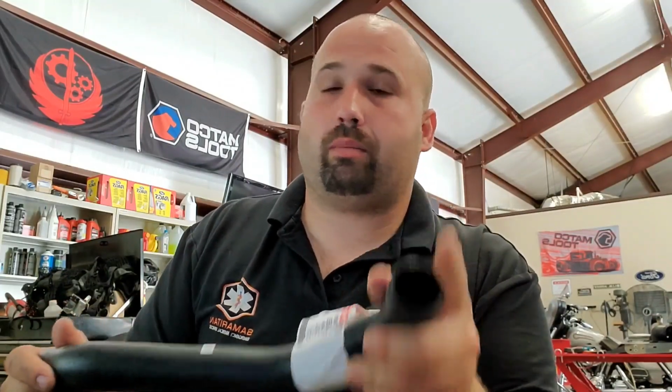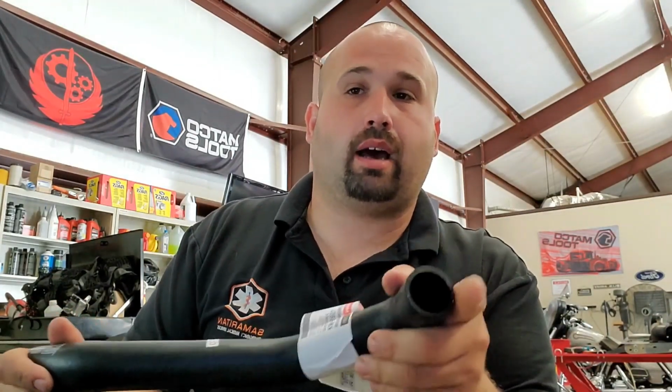And I'll show you the video of the coolant reservoir bottle, the degas bottle, real quick, and its common leak. That one's pretty sneaky because it may not leak all the time. Usually it only leaks while driving, so you really don't see a big puddle underneath the vehicle. But you will lose coolant out of your bottle. You'll lose a lot of coolant out of your bottle. And you kind of have to pull up on that little nipple that comes off of the bottle, and you'll see the leak. I'll show you here in the video.